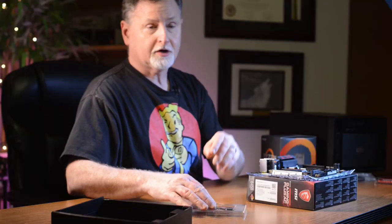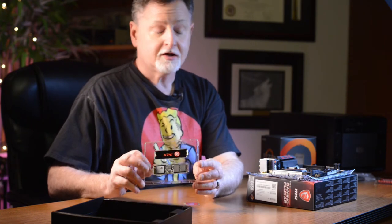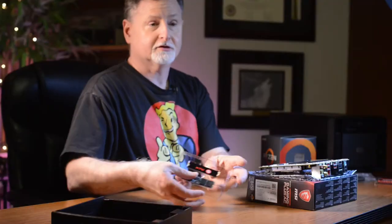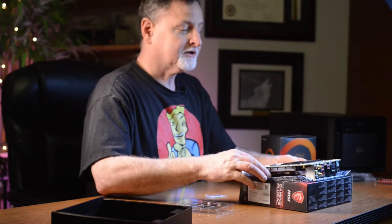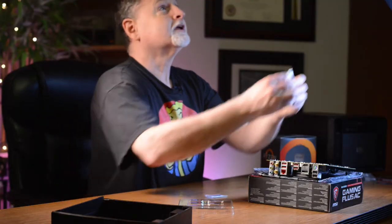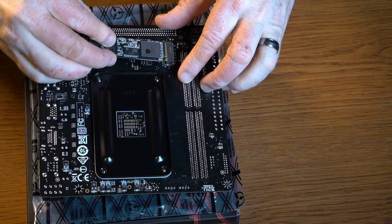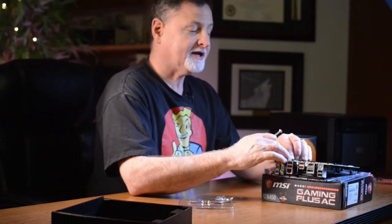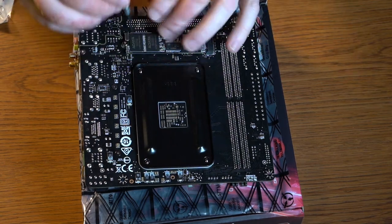Since we're using one of the M.2 SSD cards, in order to save space on the motherboard, the manufacturer put the connection on the back. This particular card did not come with a spare screw, which is why we're going to use the one included with the motherboard. To install it, you'll notice there's a little notch on the board and a matching notch on the card — you just plug it in there and seat the screw down. It takes a nimble hand to get the screw started, but once you get it in, it just screws right in. Don't over-tighten it — you don't want to crack your card.